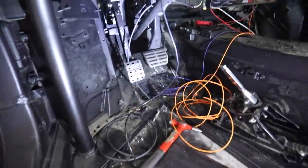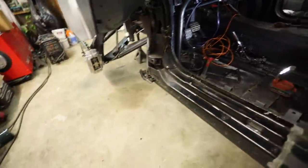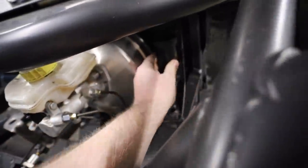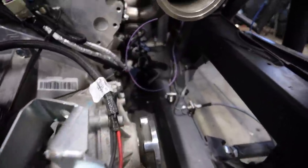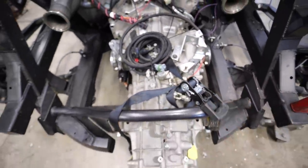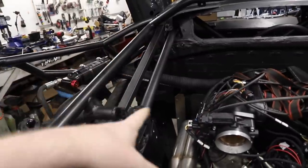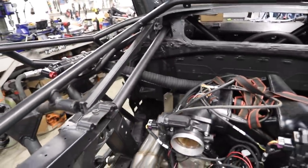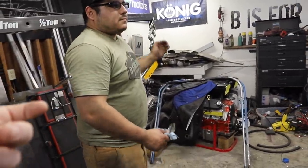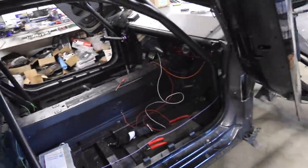The clutch is complete. We have the clutch pedal, extension — same setup as the Burnticon which we've tested and it feels good. The hard line comes out of the clutch master, runs through under the car, then a soft steel braided line runs underneath and into the bottom of the transaxle to pressurize the clutch. Kyle is going to work on the power steering reservoir and return lines. Oscar is helping mount the battery and run the battery negative to the chassis.